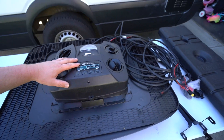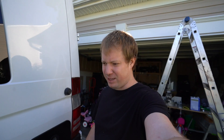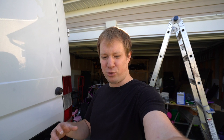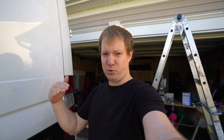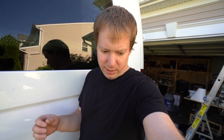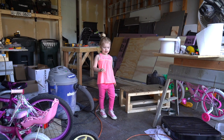It is a water-based cooling system. Here is the tank for the water. This is not your typical water-based AC system — some people call those swamp systems. Those swamp systems live inside your van and all of that moisture gets trapped in the van, whereas this unit sits on top of the roof and runs the water through a pine filter system to keep that humidity and moisture out of the van. It works extremely well, so today we will get it installed.